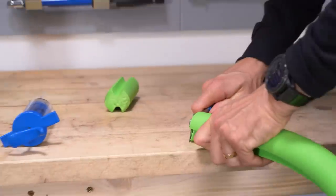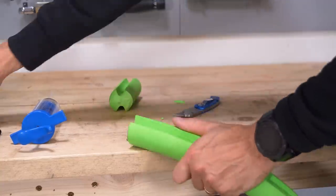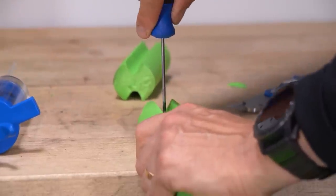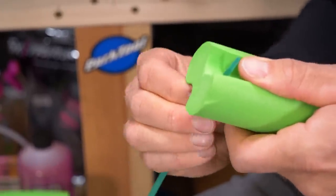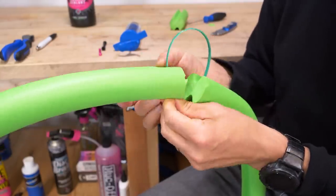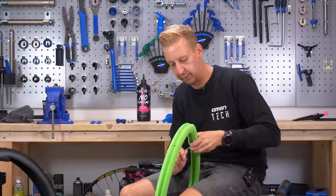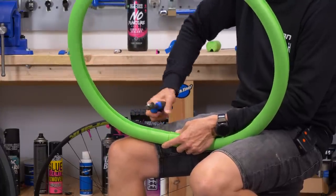Just loosen it up a bit. You're going to need to make a small hole on both ends for the cable tie to go through — I like to use a screwdriver for this, all the way through, and then the same on the other end. The cable tie then goes in through those holes. Make sure that the joining part of the cable tie — the lock on it — is on the rim side, not on the external side. You just don't want any chance of damaging the tire; it's better for it to butt up against the rim. Then secure that cable tie, pull it together nicely, and trim the cable tie as flush as you can.